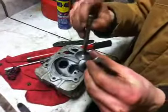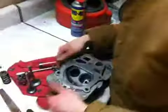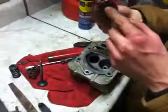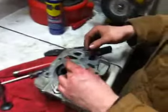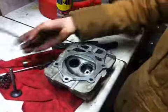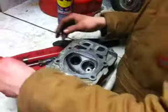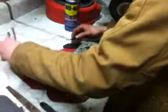That's all that holds them in. As you can see, these valves are both polished up with just a wire wheel. Then I get some valve lapping compound and the little suction cup type things that stick on here. You just go in and out and grind it up - you'll hear it grind and that smooths everything out correctly. Don't want to lose these little clips.